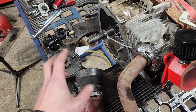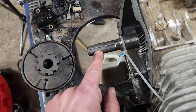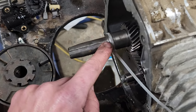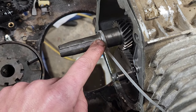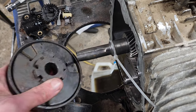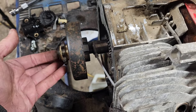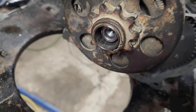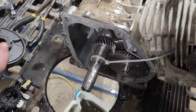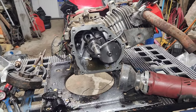I actually really like this idea, except I need a two-inch grinder, not a three-inch grinder. With the three-inch grinder I could only get to here before I made it all the way to here. If I had the two-inch I could probably make it about another quarter of an inch, but right now I'm just starting to nick that zip tie right where the seal goes. These have a little bit of a keyway right there — if I ground it out, I bet I could get it to fit all the way on. That's really close; it's going to work for what we're doing. We did get a few specks of metal in the oil, but that's to be expected — it's an experiment. Let's get it buttoned back together and fired up.